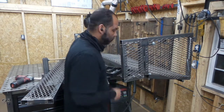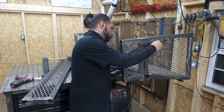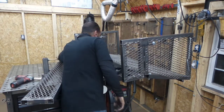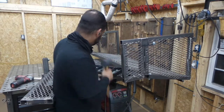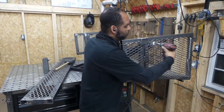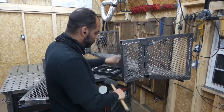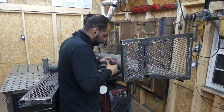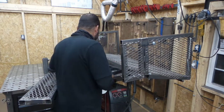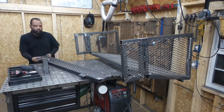There's no real structural value to the dovetail ends themselves for the ramp — they serve as an enclosure and to hold the ramp up during transport, which is where you put the latch pins. There's a bolt at the top and a bolt at the bottom, and when you install the actual flat section, that piece connects to the new extension pieces you've just installed — that's four bolts.